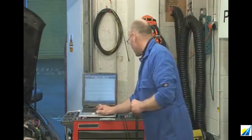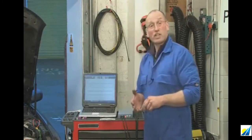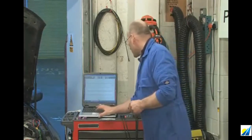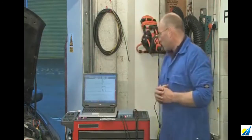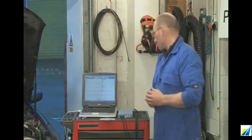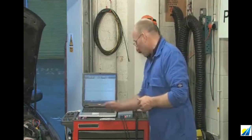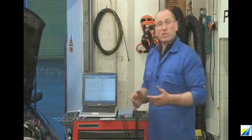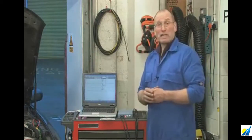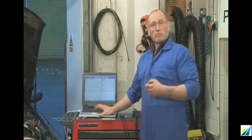At the top of the screen you'll see a pop-up menu which identifies channels A, B, C, and D. I'm going to select channel D — the pop-up menu gives a choice of changing the measurement range and also whether to turn it off, and in my case I'm going to turn it off. Likewise for channel C. The beauty of colour is that colour separation gives a very clear indication between one channel and another, making it much easier when looking at multiple inputs. We now have two channels, A and B, active.